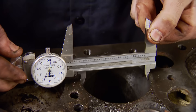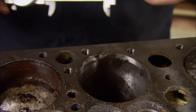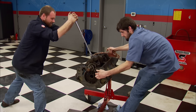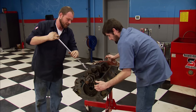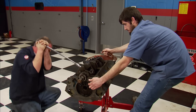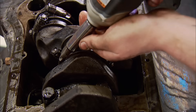Even the new bearing sizes are stamped on the counterweight. John grabbed the calipers to check the bore — looks like 3.250. It's been bored. Now let's see if we can loosen the rotating assembly without the valve train's pressure. She ain't budging. I think we're going to have to break the pistons.